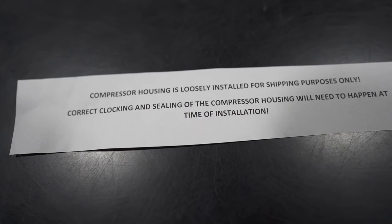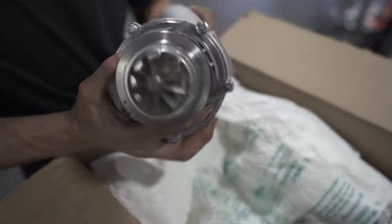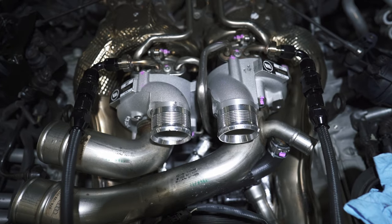Now, as far as our selection on aftermarket turbochargers, I went with the HPA Motorsport RS7 hybrid turbos. This is basically going to be a simple OEM replacement — nothing too crazy, not an oversized turbo or anything ridiculous. I'm pretty well satisfied with them. The only thing I will comment on: if you decide to pick these up, they do work well, however there is a piece of paper in the box that tells you they have to be reclocked prior to install. They're basically just loosely put together for shipping purposes. You have to separate the cartridge from the housing and reclock the turbo to get everything to line up. Once that's done, your turbos are ready for install. My only point of criticism is I really wish these were fully assembled, drop-in-ready turbos. For the money, I can't complain — the price point was reasonable.